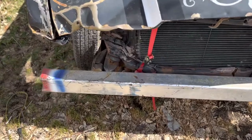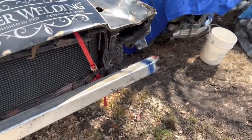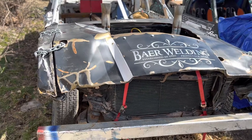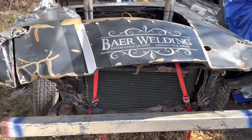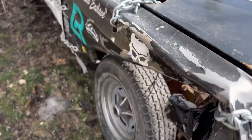So this bumper — you can bend rolls. You're supposed to have four inches of weld on each side. I won't lie, there's a little bit more weld, but I needed it because this car had a reputation for knocking bumpers off — and it wasn't other people's, it was my own. Chain-and-band — you can read the rules, but literally, rather than welding up, you chain up. I've got chains all the way across.